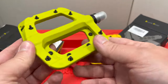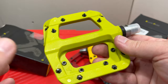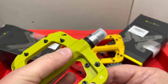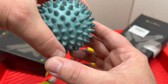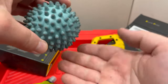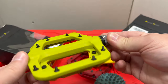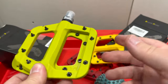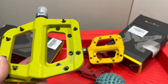What's the difference? This standard pedal is fine for the average rider, even advanced riders — just like the Race Face Chester. When I say sealed bearings, they don't have the rubber seal on them; they've got the metal seal inside. They're encased between each of the three bearing positions. Imagine a ball sitting inside a closed cage and rolling — the wear point is going to be on an edge, and eventually that will flatten out. I've been using this type for years and years.